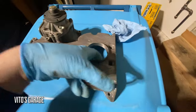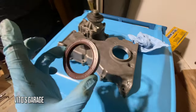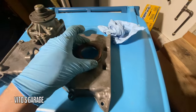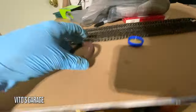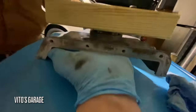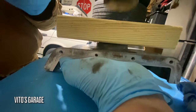After this is all cleaned up, we're going to install this new crank seal. It's all clean. We're going to install this crank seal. I'm going to add a little bit of oil on both sides. Just see if you can hammer straight down carefully — tap, tap, tap.